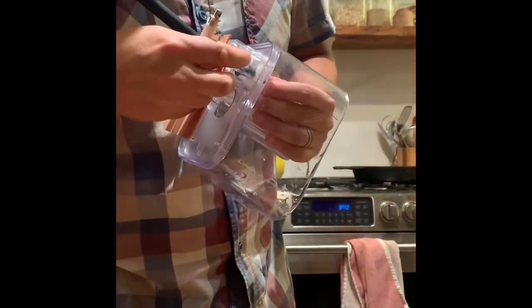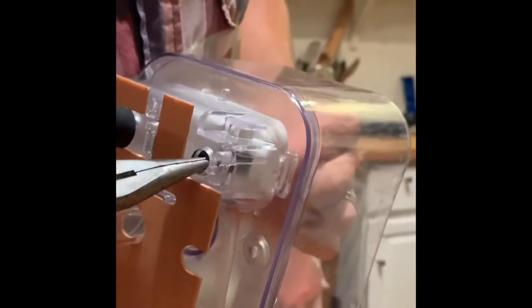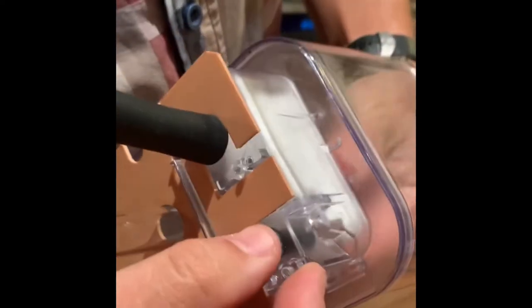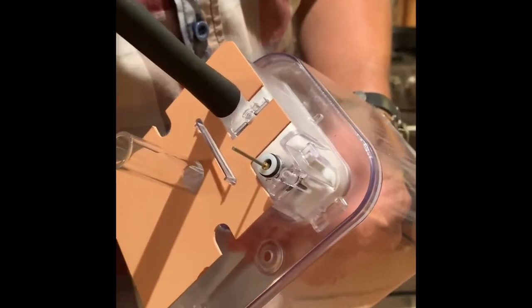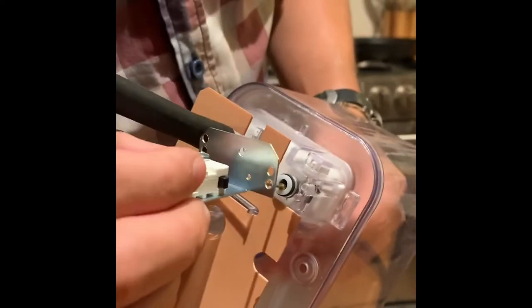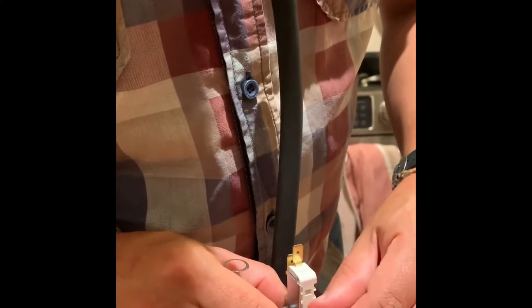To get the new floater back in, use needle nose pliers and carefully work it in without pulling too hard. Put the little plastic insert back in to hold it in place. The rod goes back in and sits there — it's held in place by the switch. Make sure the rod goes through the tiny hole on the switch so that it pivots correctly and will hit the switch.